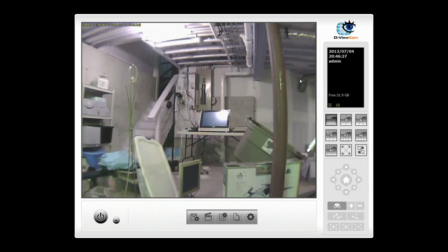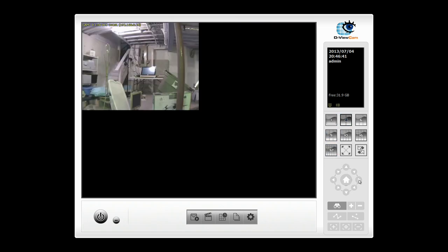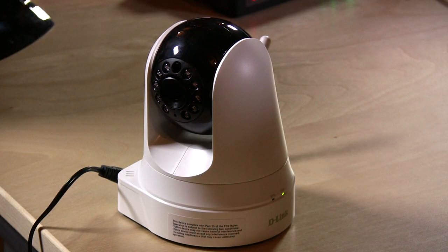There's one more thing — they include a Windows-only security system application that allows you to group a bunch of these cameras together. You can set them up in four-way, six-way, up to 32-camera views. It's a pretty complete security system including the ability to set up patrol zones, so you could have the camera do a complete sweep of the area every hour, or look at certain areas more often. It works like a DVR — constantly recording and alerting you to motion events, then deleting old footage after a set period.